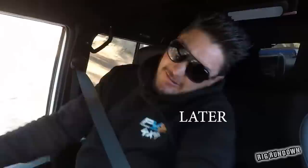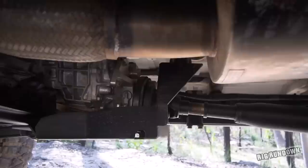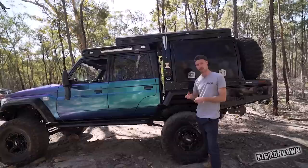The handbrake's also improved. So it's got a drum on the drive shaft now. So it's not got the stupid brake handbrakes that go inside the drums on the rear calipers. Now that's all moved to under there on the drive shaft, so it gives a lot nicer handbrake. So it's not got that typical 79 handbrake crap that people hate, so let's fix that.